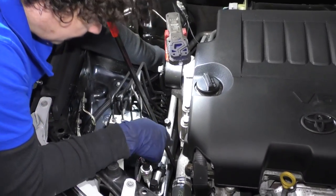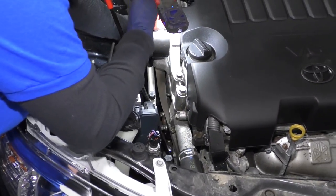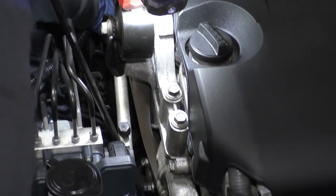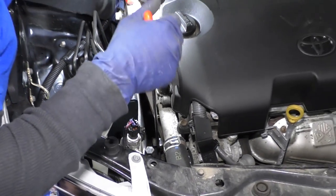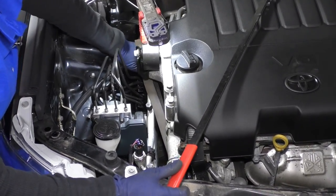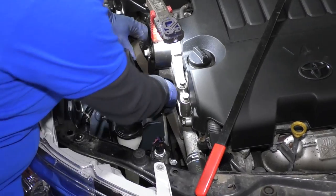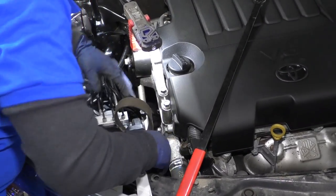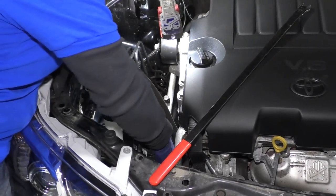It came off the crank. So I took the belt around the crank, around the pulley, and brought it out back here under this wishbone mount motor support. So now I can take the tension right off and slowly let go of the belt, then just slide the belt up off the crank and pull it right out.